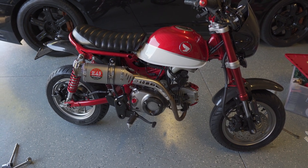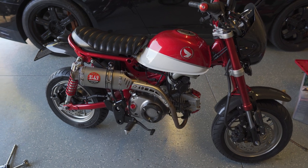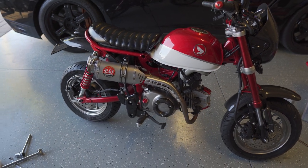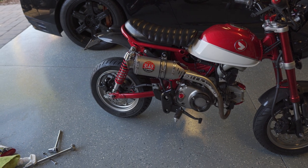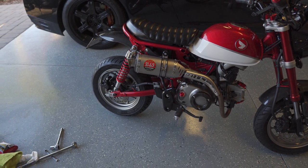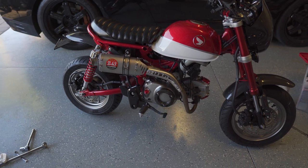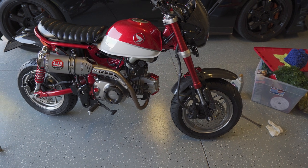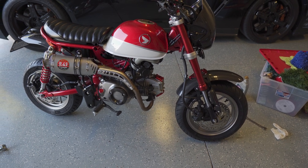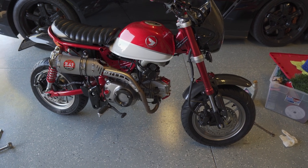While I was able to get all the way up to 76 miles an hour with the 15-tooth, it seemed much more rideable with the 14-tooth. So I'm going to do some more experimenting — I could potentially change some of the rear sprockets if I wanted to really fine-tune that. But I really like the way it felt with that 14-tooth. So I'm going to do some riding with these tires and sprockets, see where I am with the gearing and how it relates to my speedometer readout against the GPS, and then figure out where to go from there. Alright guys, thanks for watching.